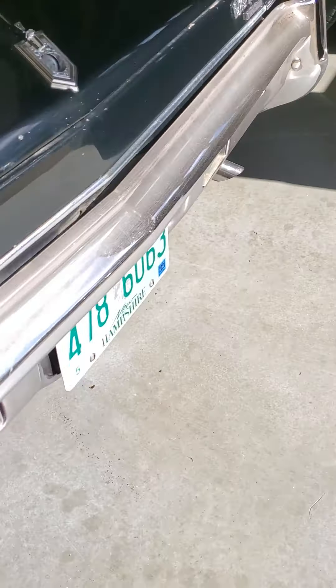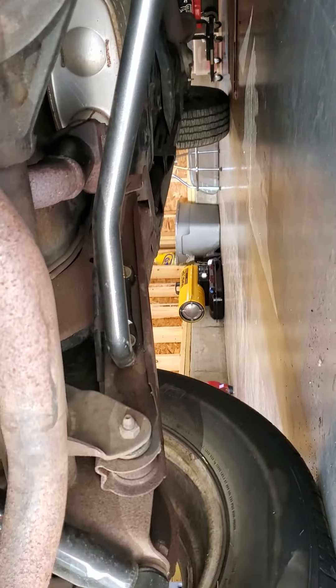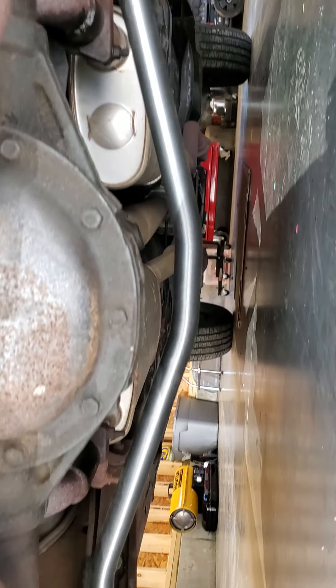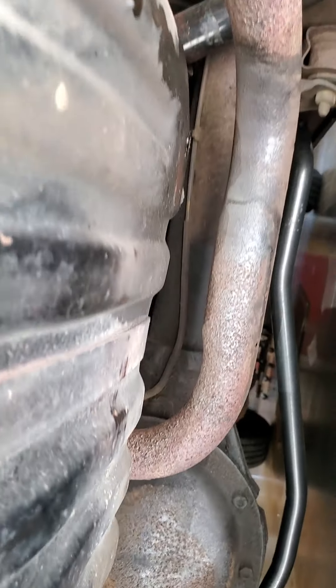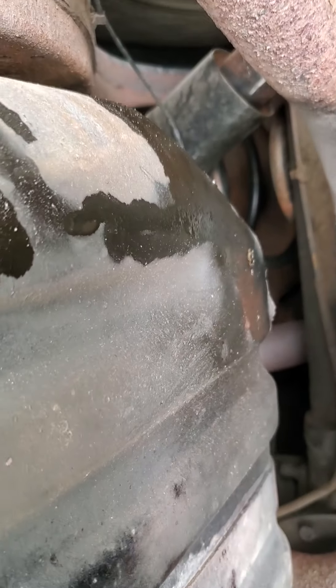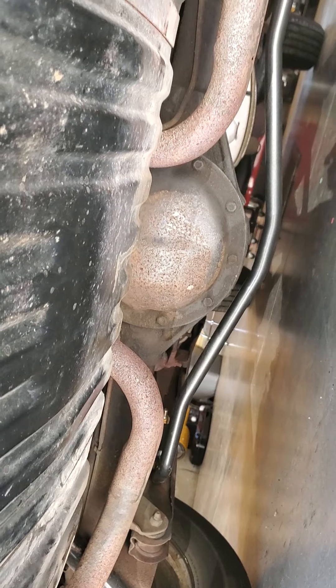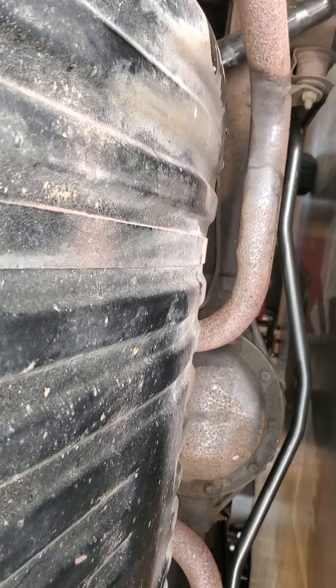The biggest thing I did was get the rear stabilizer bar installed. When doing this I realized that the bushings on those lower control arms are shot, so I'll be ordering a new set of those and putting them in this winter. I got a good look underneath the car and everything looks pretty good. I think there's a tiny bit of a gas leak up there, but I'll figure that out later — I think one of the gaskets on top might be leaking. The tank's relatively okay but I'll find out for sure when I get it out.